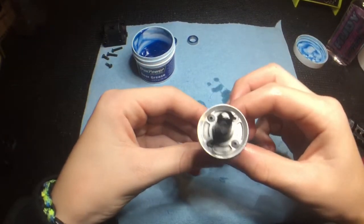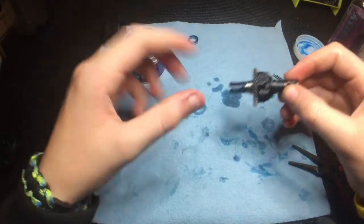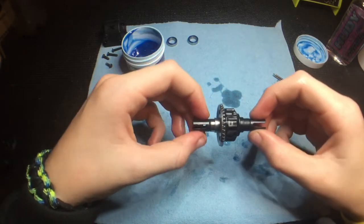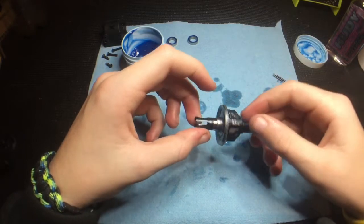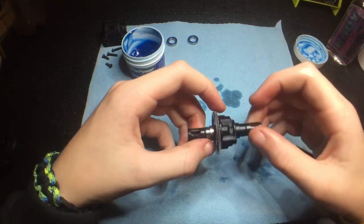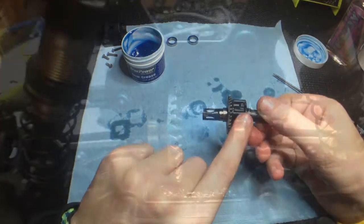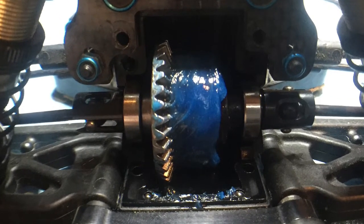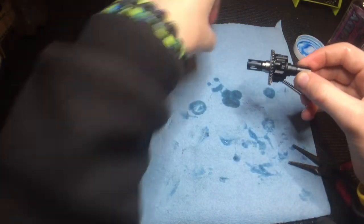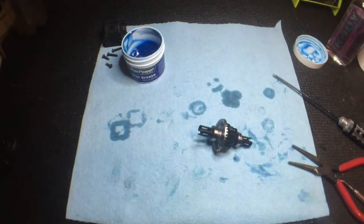And there you go — that's your diff. Before you put it in, you want to coat the ring gear completely with gear grease, just to make sure the gears last as long as possible. You can really never use too much grease. I keep adding it and spin it around with the pinion gear in the gearbox and wait for all the plastic to get coated up. Once I feel comfortable that I have enough, that's how I rebuild my gear diffs. Thanks for watching guys, see you next time.